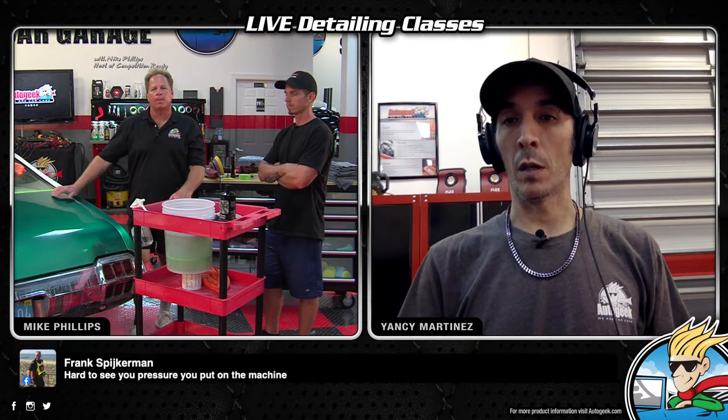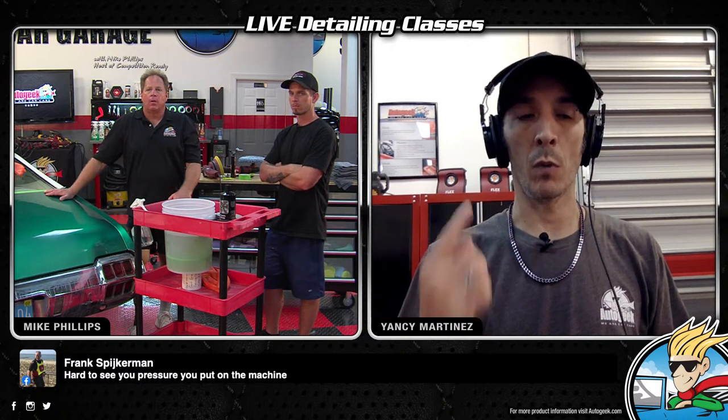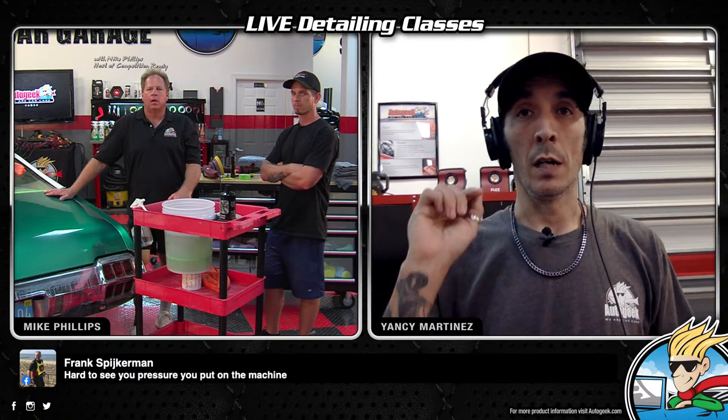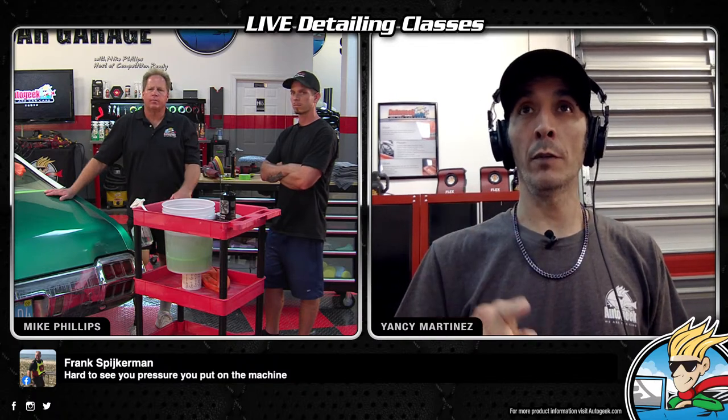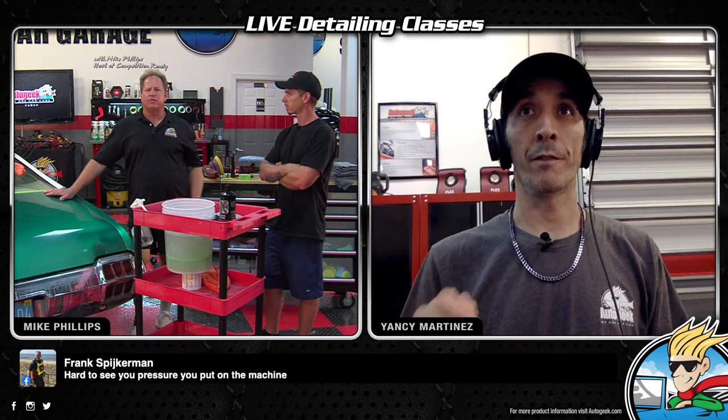Okay, we have Frank coming in. Hard to see the pressure that you put on the machine. I think you were talking about while we were wet sanding. So that was very light pressure, maybe like 2 to 3 pounds. When you're using the rotary, about how many pounds of pressure are you putting down? I think we're like 5, 7, 8 pounds.